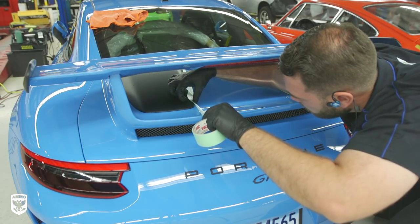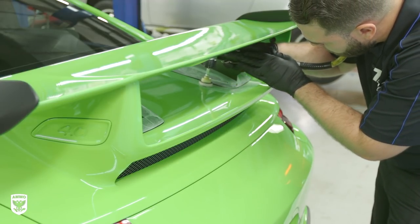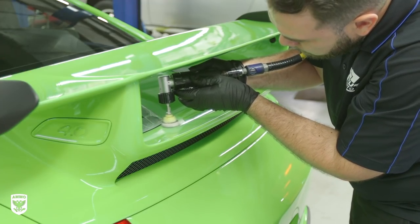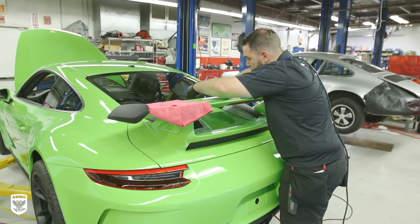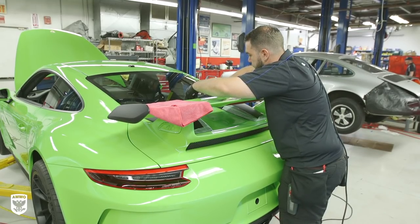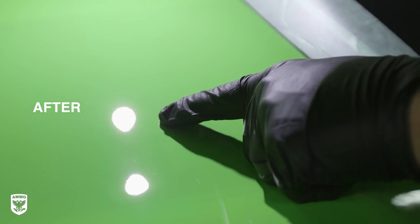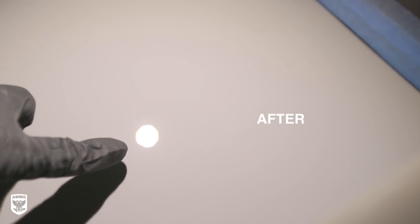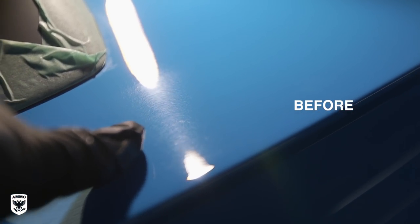We masked off the matte intake scoops and polished with the Kevin Brown 1-inch special around the edges of the scoop with M100 and a microfiber cutting pad. Next, we followed up with the 3-inch on the larger areas and finished with M205 on the 3-inch foam pad. The paint was relatively soft on all three rear decks and they cut well and finished easily. My guess is the pigtails were present on all decks because the shape and tight working space didn't allow for the best sanding position or line of sight for the worker at the factory.